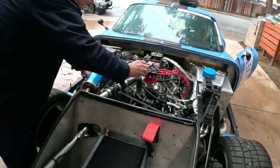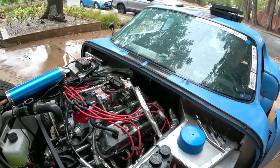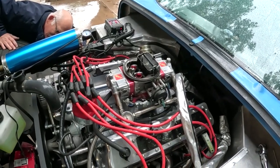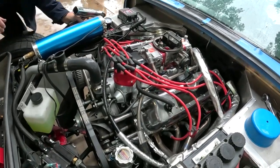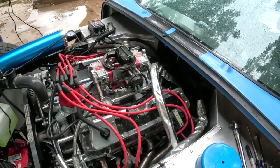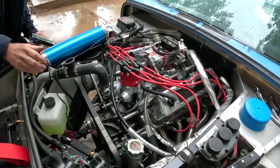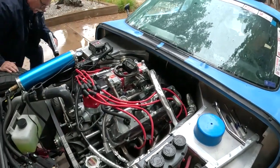Okay, let's try just a teeny bit more. We're gonna get a little more advanced. I'm gonna time it while you do it too — see if that thing's actually moving or not. Now it's getting better, that sounds like it's wanting to fire. Give it a little more. That sounds like we're getting close. Moving in little increments, probably another four or five degrees — fire it up.